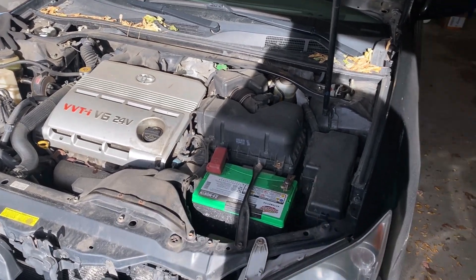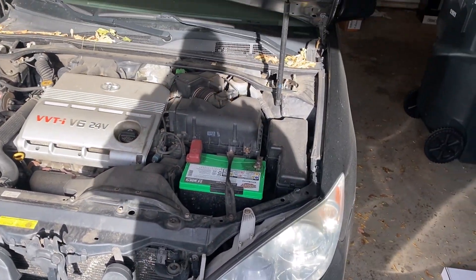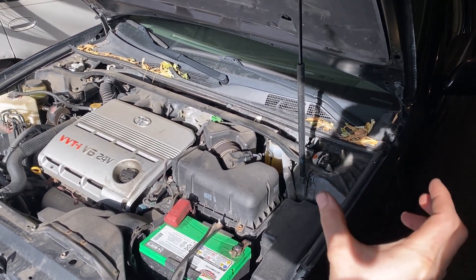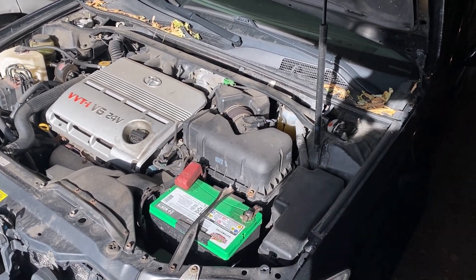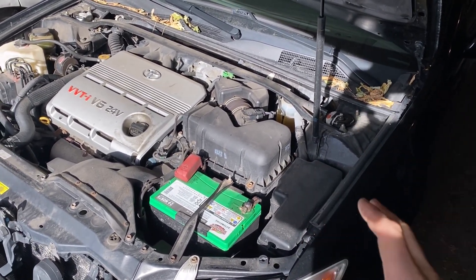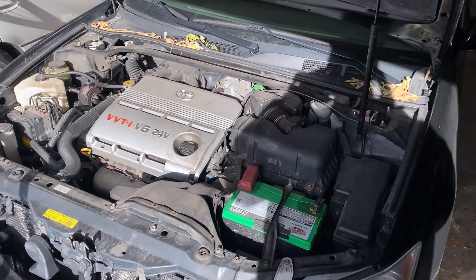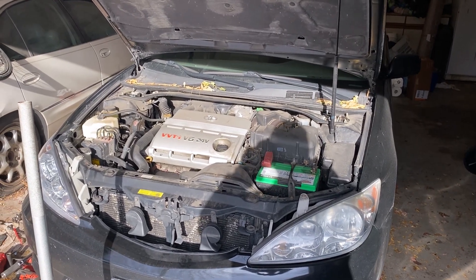I'm not going to show doing the other side because it's the same steps as the side we already did. However, I will make this important note: once you're done, you have the wheels torqued, it's back on the ground off the jack and stands — make sure you hit the brake pedal a few times. If you just start the car and drive or throw it in reverse, you're not going to have brakes right away because your caliper pistons are all the way compressed. When you hit the brakes they're just going to push out and there's not going to be anything there yet to grab. Definitely before you even start the car, hit the brake pedal a good five to ten times until you get a hard pedal, then start the car, do the same thing, and make sure you've got a nice solid pedal before you drive anywhere. Hopefully this video helped you out — if it did, make sure you hit that like button and consider subscribing. Also check me out on Facebook at Tony the Truck Guy.